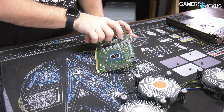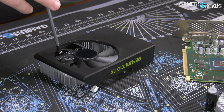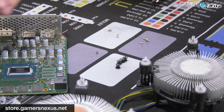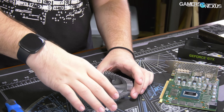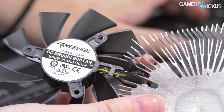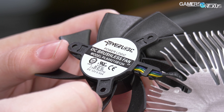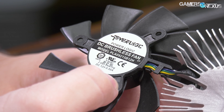Let's also take a look at the fan, doing screw tracking on the ModMAT grids to keep screws separated. There's the shroud — this was made in January 2021, so it's fairly recent. And the fan: PowerLogic. We've actually interviewed them — there's a video on our channel. PowerLogic is a really common supplier; they work with EVGA and have worked with ASUS in the past. They make fans and things of that nature. This is a 12-volt, 0.55-amp fan. If you needed to replace it at some point, there's the model number — you might need that if you have one of these cards. This is a double ball bearing fan.